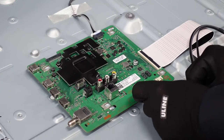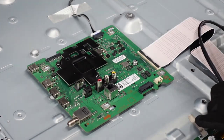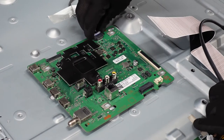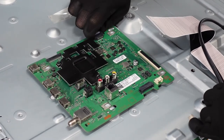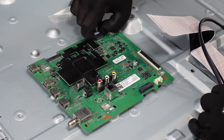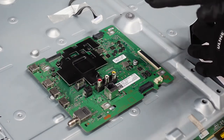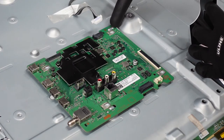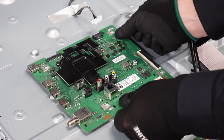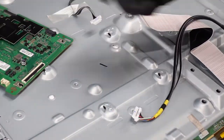If it's not coming out even, you'll just want to push it back in. There we have that one. Ribbon cable — fingernail, flat, pull it out. This one up top, same situation: pinch it on the sides and kind of pull it out away from you. There we go. And this one here, as previously stated, no screws. We've just got a little bump right here — we need to get up over that lip there and we should just be able to slide this whole thing out. And there we have it.